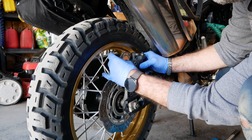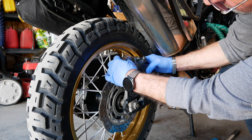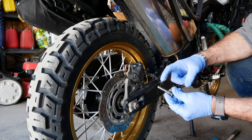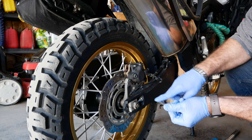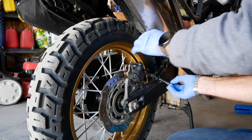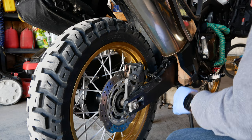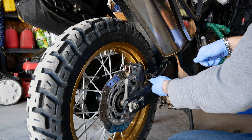When you're installing the brake caliper back on, you want to make sure you put the back bolt in first because that one usually gets more tricky. Then grab the other bolt that goes in here, and you want to coat that sliding part as well with a little bit of silicone grease — a little goes a long way, just coat it gently. Wiggle it a little bit and it should come into place. Just a little bit of tightening — not too much, just enough to grab the thread.